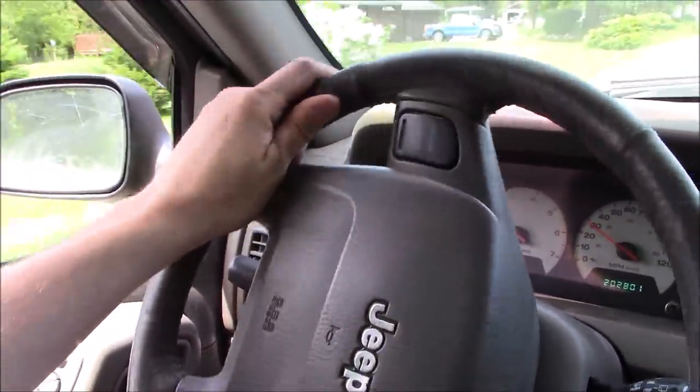We are out here on a test drive and so far I am really liking this. Right off the bat the first thing I notice is how much it just seems like this thing tracks straighter down the road. It just seems so much tighter — when I rapidly spin the wheel the thing feels nice and firm. I think I must have had an issue also with some bump steer from that extreme angle of the track bar because so far I'm just not noticing that anymore. This thing just feels a lot safer to drive. Clearly my steering wheel is way off though, so we do have to adjust that, and I'm not quite getting my full range of motion especially to the left.